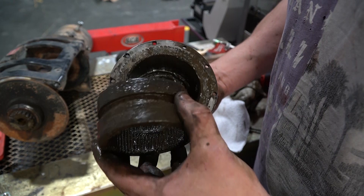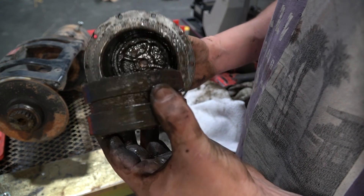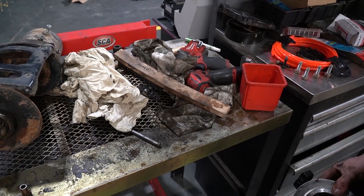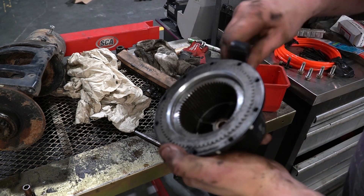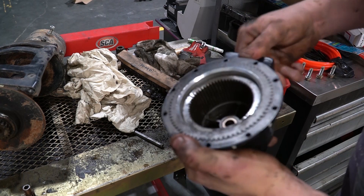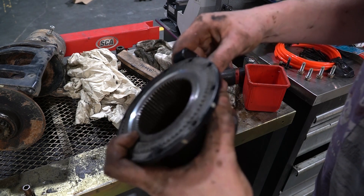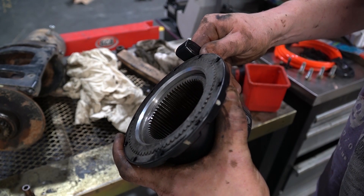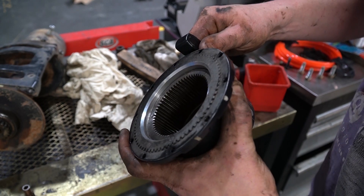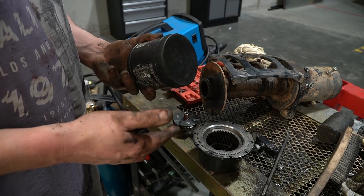Pretty much that — full of shitty gritty nonsense. I think when I seal this thing up again I'm going to put gasket goop on it, because I don't want anything getting in here again. Now by the powers of video editing, this is now considerably cleaner than it was. And that's also how it's supposed to work — it's pretty similar to a freewheeling hub. It'll engage on the splines, but then as you engage the clutch it moves the gear wheel further away so it disengages, meaning the motor will turn but the gearbox won't. Now I'm going to use molly grease for this — it's probably not the exact grease you're supposed to use, but so what.